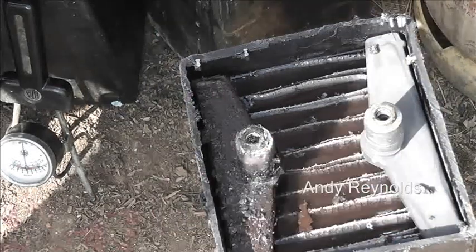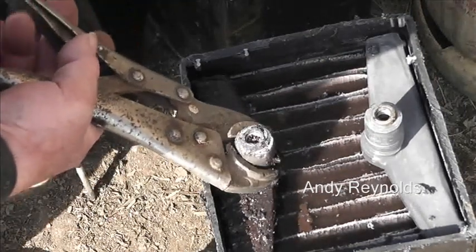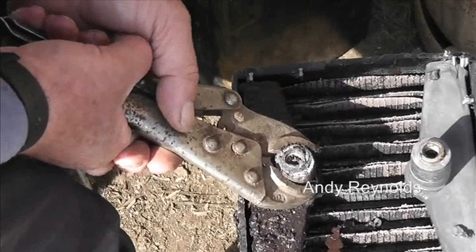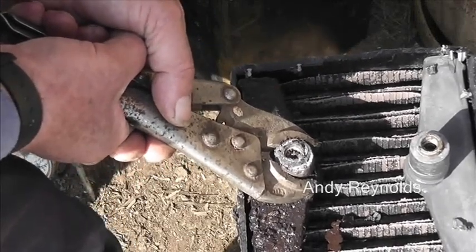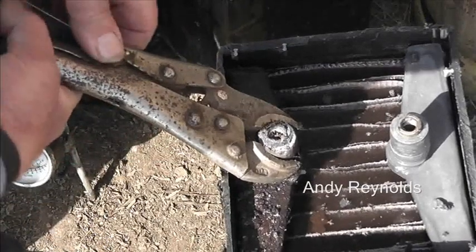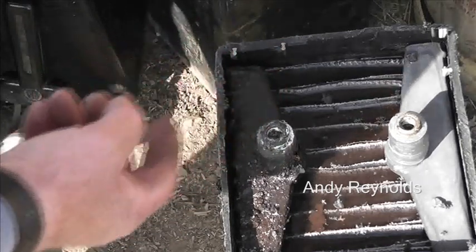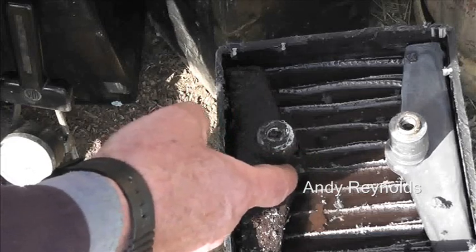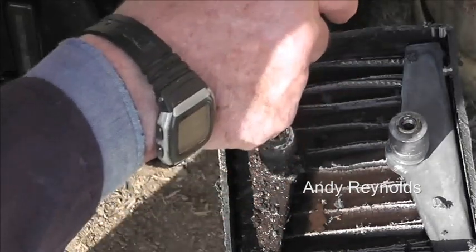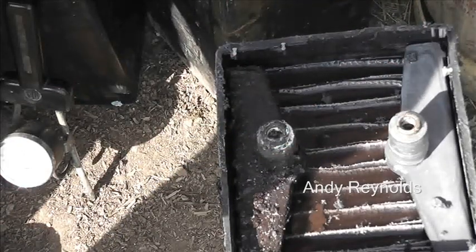You see the negative looks beautiful and clean. Whilst we're here, let's just lift this out. Look — these brown plates here, they look nice and clean. If they were sulphated they'd have white bits all over them. I think if we actually lifted this out and took it all apart, we'd find that in the plates there's a bus bar that runs along the top and a mesh that runs down, and that starts to rot out over time. But it looks a lot better than I thought.